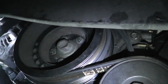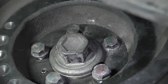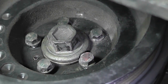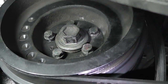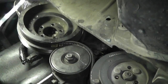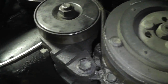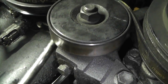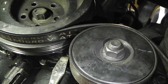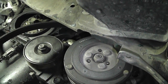We don't want to loosen that middle 17 millimeter bolt — we just want to use it to keep it from moving out of top dead center. There are actually five eight millimeter bolts around the outside of the 17. I'm just holding the 17 like I was going to crank it tighter, so I can use it to apply pressure while I apply lefty-loosey to these little guys. Getting this off — once it was wedged on there from the belt tension — I took a screwdriver, stuck it against a bolt there, and was able to pry it and it just popped right off. Pulley is done.